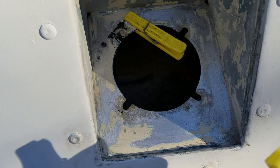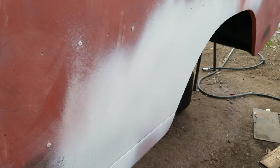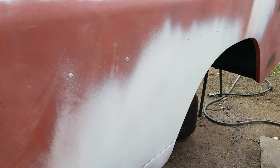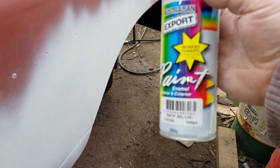Tomorrow I can sand that off, finish sanding up this hole and get some primer on it. While that hardens off I'll start looking at this last little bit of repair on the left hand side. There were just a few scratches that hadn't quite filled in with the top coat from the previous coat of primer, so I'm going to put a guide coat over this now.